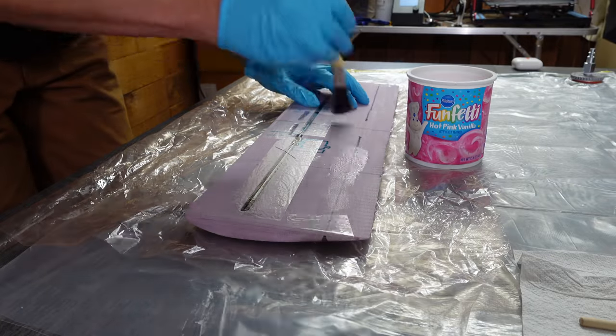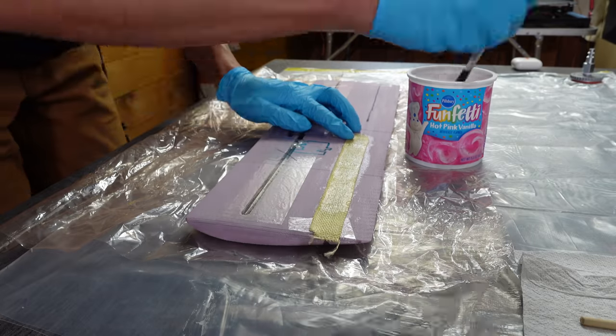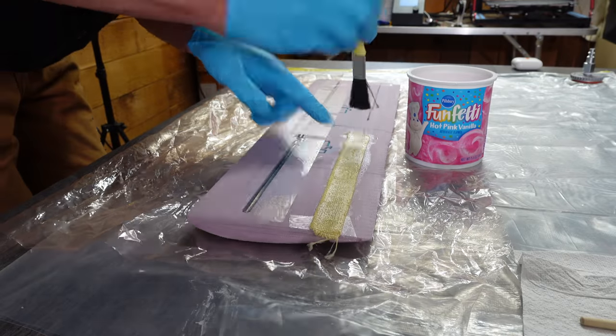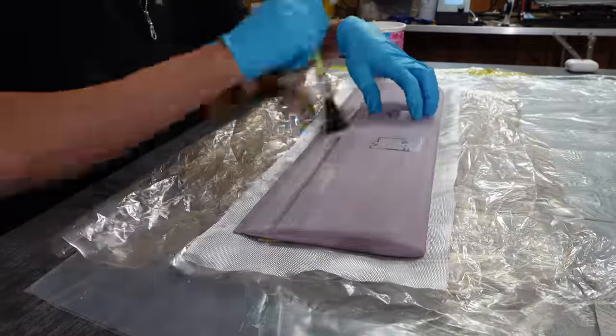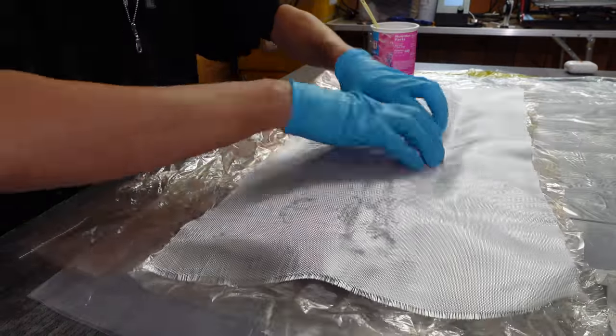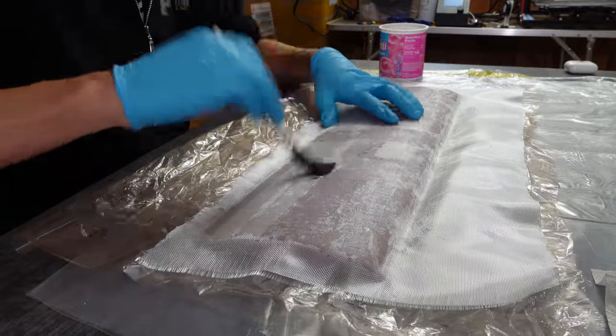To make the hinges themselves, I'm using Kevlar ribbon. Kevlar is so durable that you can crack the epoxy inside of it and the threads remain intact, so it's flexible. After that, I did a layer of 2oz fiberglass, and then another layer on the other side. I'll be the first to admit that for such an experimental vehicle, I kinda went way overboard with the construction techniques. But that's okay, because I was just really eager to try this stuff out for the first time.